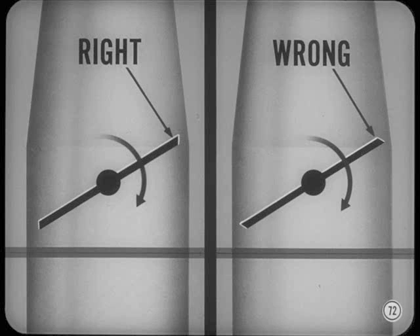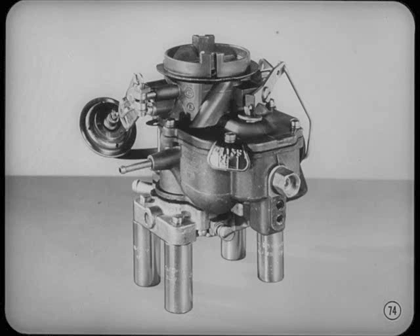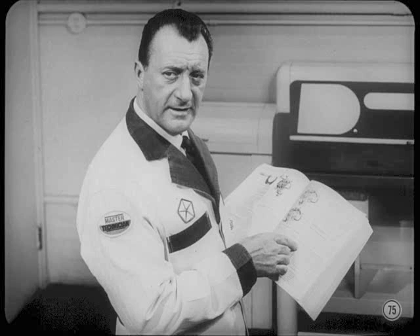Make sure the valves are put in right side up — if either or both valves are turned over, they can't close correctly and may jam on the throttle bores. How do throttle valves get out of alignment, Hank? It usually happens when somebody gets careless and bumps the throttle valve edges against a hard surface — just a tap can cause valve interference. The best way to protect throttle valves is to prop the carburetor on extension legs or use a good carburetor holding fixture so that the valves are raised off the work surface. That's all for valve alignment. Idle adjustments are next.